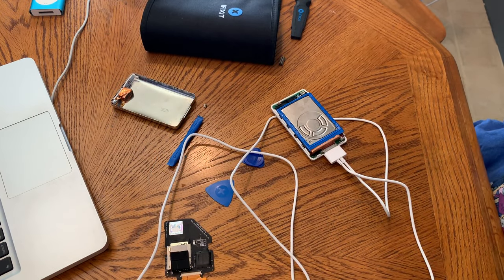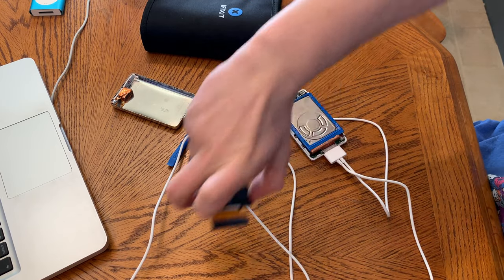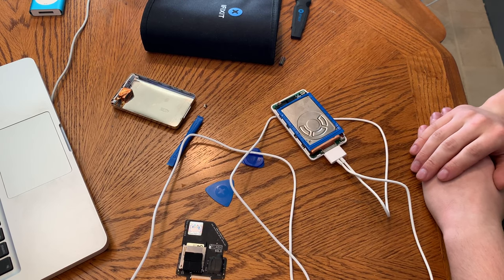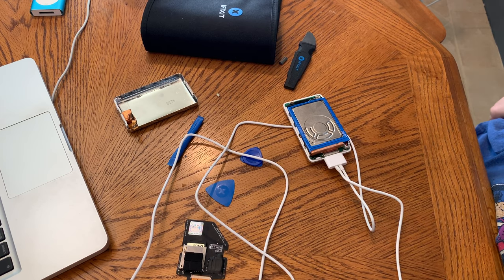I'm trying a different trick — I'm going to restore it to Mac first with the original hard drive, then clone that and stick it on the SD card. iTunes did identify it as a 64 gig iPod, but it still wouldn't boot because it needs restored properly. Disk Utility still didn't let me clone it, but Carbon Copy Cloner is actually cloning the entire drive properly this time. It finished in 52 seconds and it looks like it imaged the whole drive properly.